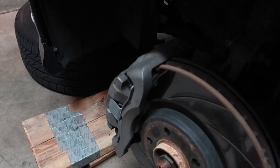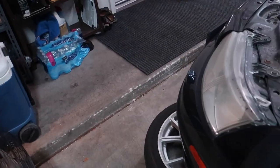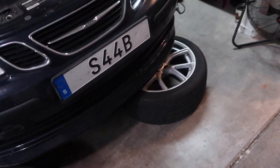That would also be a good time to check your brakes and see how your pads are, all of that. So I'm going to go check the tire pressure now and make sure they're all at 35 psi, and it'll be good to swap them around.